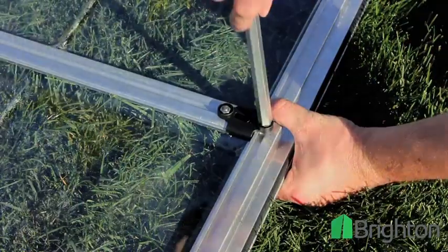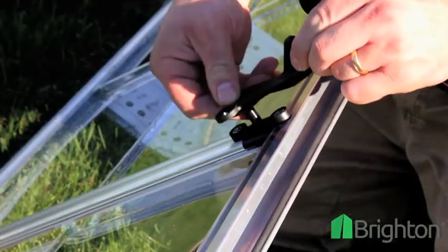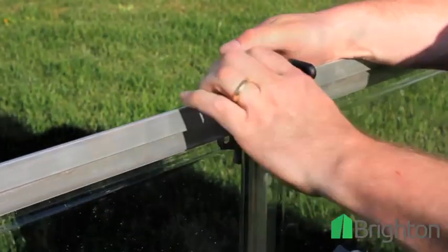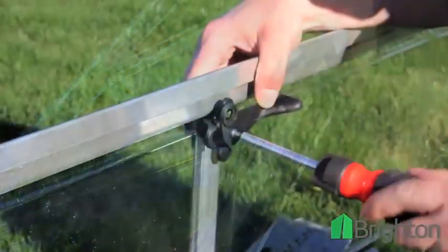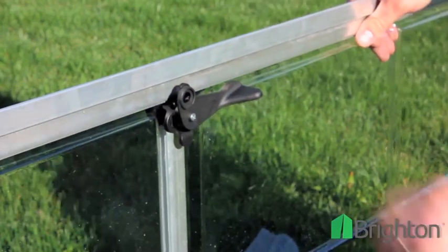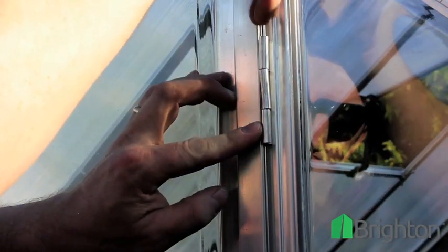Install the back plate in the latch at the gap of the center door support using the bolts you slid earlier. Slide in the inside handle, making sure it's pointing outside the door. Snap in the front brackets and attach the front handle. Secure it using a long bolt and nut. Begin to install the door by lining up both hinges, inserting the pins, and tightening the bolts.